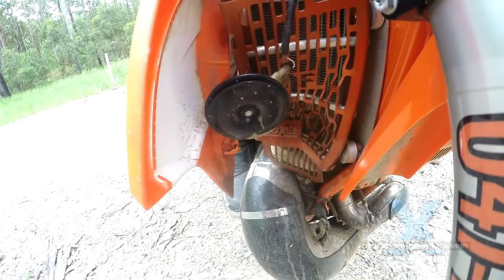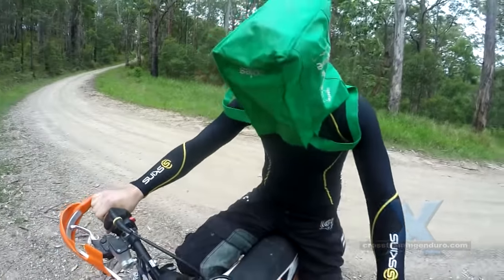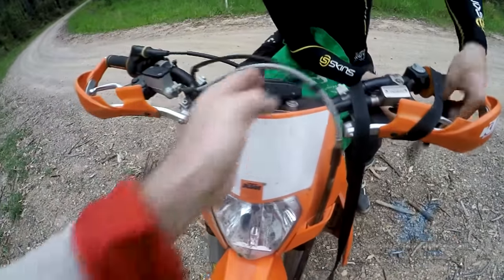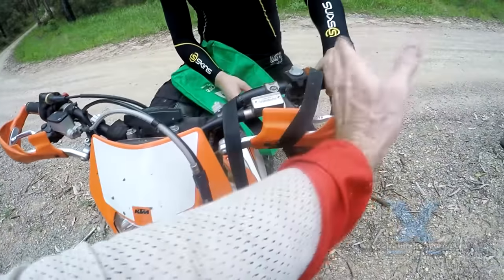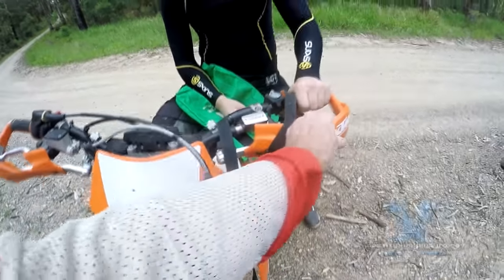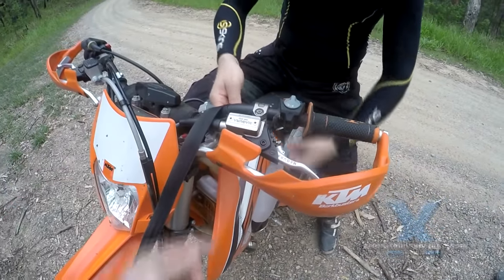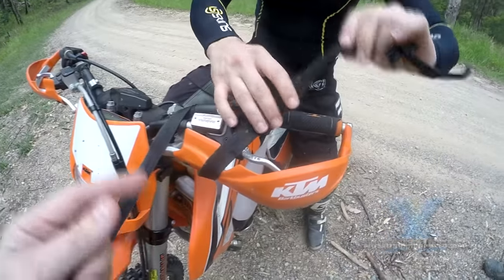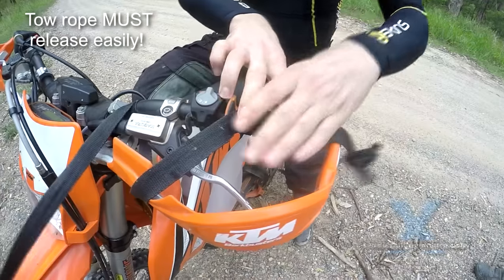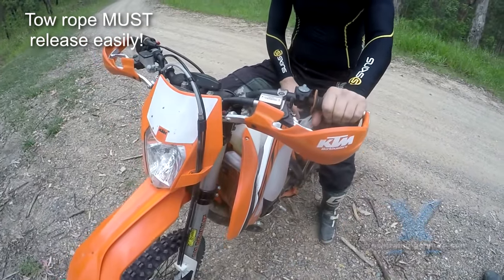Now we have our anonymous rider, very embarrassed, holding his radiator. Scott, you're staying anonymous. Here is how we hold the tow rope — the key is you want it as central as possible. If you tie off here, every time the bike jerks the tow bike your steering's going to go to hell. So we're keeping it as central as possible, wrap it around, and then this is the very important thing: how you hold on to it, because if things go bad we want to be able to let go and the strap just flies off.